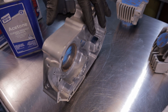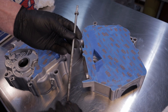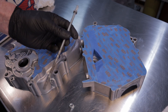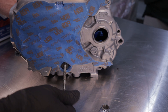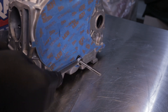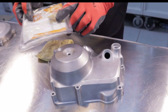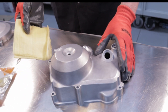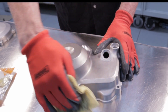Now we're on to the fun stuff — the cases. I came up with an idea of passing a threaded rod through both cases and then bolting them together. That way I do not have to mask off the centerline of the cases. It worked out really well, so I'm going to do it again. When you clean the part with acetone and you've gotten a clean cloth back, it's time to go to the final step, which is using the tack cloth. A tack rag lifts off any additional lint or dust that might have been left behind from the towel or gotten on the part since you last cleaned it. Just go over every surface with a tack rag and then we're ready to paint.